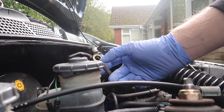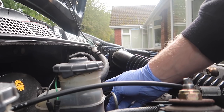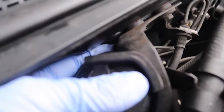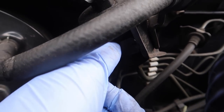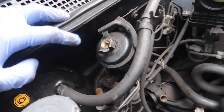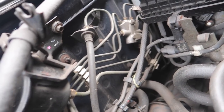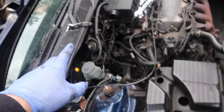This goes to your fuel rail, so there's going to be a little bit of fuel in this — just try and keep it upwards so you don't get fuel all over your engine bay. The next bolt is underneath, which you're going to need a spanner for. There's also a bolt around the back — that's how you take the little harness off. The harness for the fuel filter goes onto there, so that's going to come off. I've undone the bracket at the back, it's just a little 10mm bolt. Now all that's connecting it is just the fuel lines.